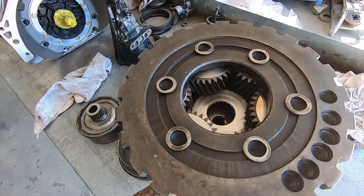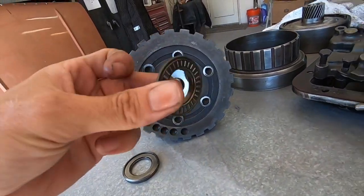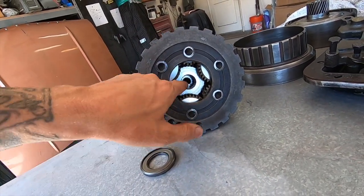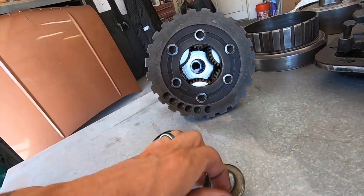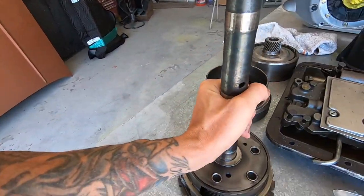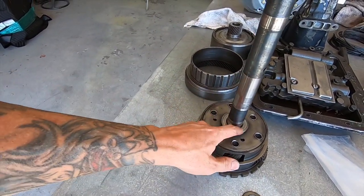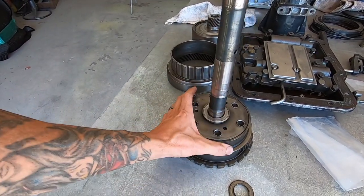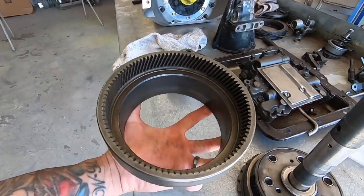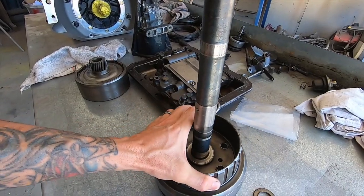There's a bearing that sits on the face of that - there's a little pilot bushing you can see here. We'll have to get that straightened out obviously when we insert all that. This is special to this because on the 182 it's actually captured because of the way the gears are, and it's smaller, so that bearing doesn't slide out - whereas this one will come out. If you get a 182 gear set you have to have this bearing to make it work. This bearing slides over and rests here - this diameter is larger, so you will need this bearing with your planetary gear set because the one from the 182 will not work.